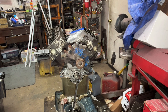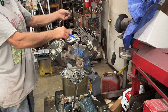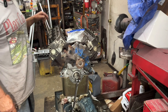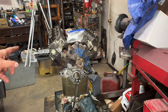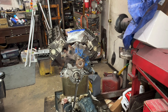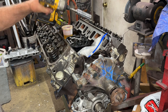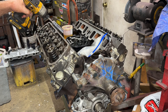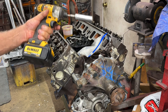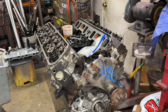I got my head bolts, push rods, rockers — everything is here. First I'm going to swap out the wrong head bolts for the correct head bolts. I'm just going to use my quarter-inch impact to take these old bolts out one at a time, put the new ones in one at a time. This is going to be perfect for the first torque sequence. Let me get started.